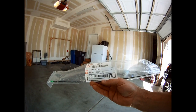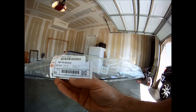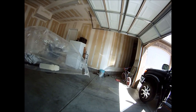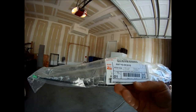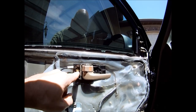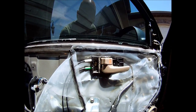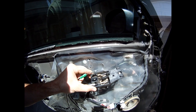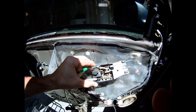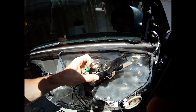I went to the local Toyota store — they had this in stock ready to go. This is the replacement part; that's where it broke, just where that little tab connects to the wire. This is about a seven dollar fix. To replace the wire, there's a 10mm bolt right there — got to remove it so we can detach it from the handle. I removed that 10mm bolt and this part right here just pops straight back off and comes straight out, detaching from there.